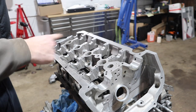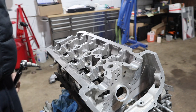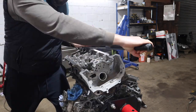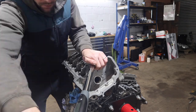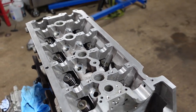Now I've got to go over them all again and do 90 degrees, and then again another 90 degrees - I'll skip ahead and do that. With the left bank now on and the head fully torqued up, we can now go ahead and fit our camshaft lifters.